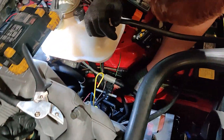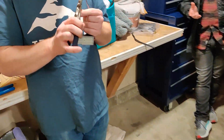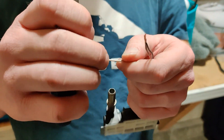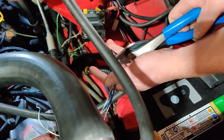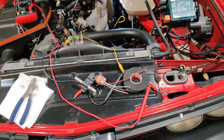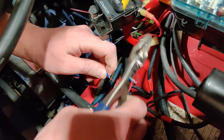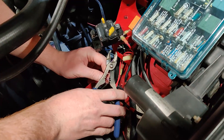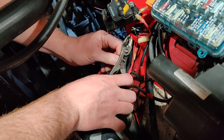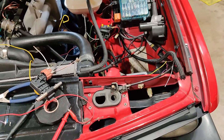In the future we'll be making a plate for this to sit on, but for now we're just going to use zip ties to get it in place. Moving on to the wiring — there are three wires that come out of the sensor: 12 volt, a sensor ground (not a dirty ground or a common ground), and the sensor output that goes back to the ECU. We're trimming the runs from the Mega Squirt to length, finding a good spot, stripping them back about a quarter of an inch, and getting them ready for some heat shrink butt connectors.